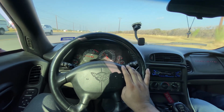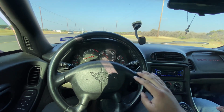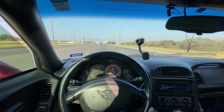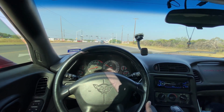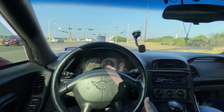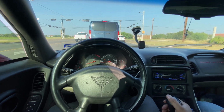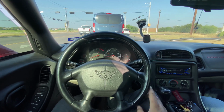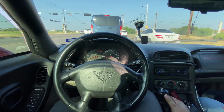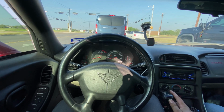The only reason we use the dyno a lot is it's unsafe trying to dyno on the street, trying to floor it on the street. I don't like to do that. Also, if anything happens, it's there in the shop. You know, we're not stranded. Another thing is also cops breaking speed limits. The only thing we do on the street, if anything, is drivability, but that's just regular driving, making sure that when we come to stops, it doesn't turn off, it doesn't misfire, it doesn't overheat. But as far as flooring it and making sure that the car is clean, we do everything on the dyno.